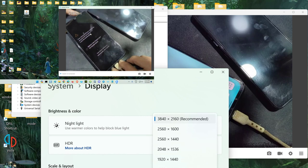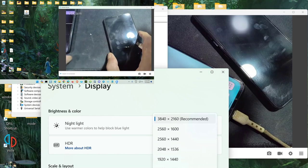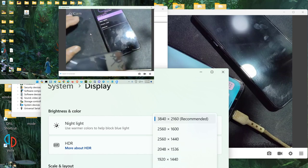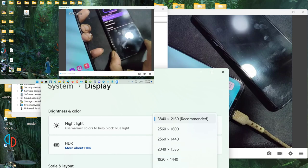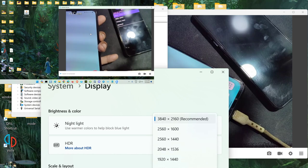It's in the recovery of this Lineage. Right? Just connect the G8X to the V50S. You see, this is the custom recovery from the boot image of LineageOS. Because LG doesn't have a recovery partition, and the stock recovery on the boot image also has a problem with the touch screen, right? Your V50S, you can turn it off.